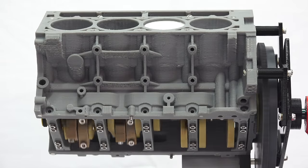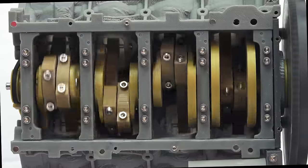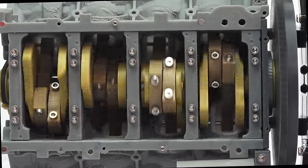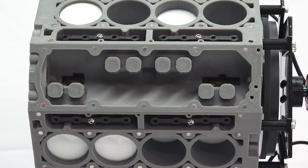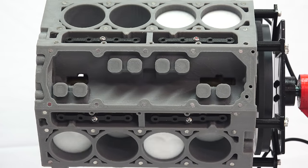This is actually balancing out a rocking moment caused by the piston's movement. In full swing, though the whole engine may look complicated from a balancing standpoint, it actually is extremely smooth running, with no first or second order vibrations, and only a first order moment that is countered out through the crankshaft design. All of this is to say that the engine runs very smoothly.